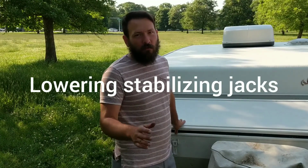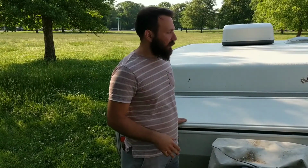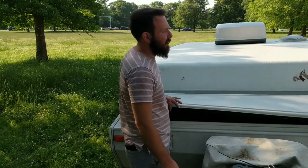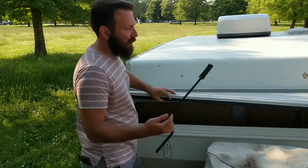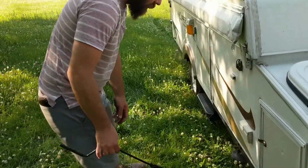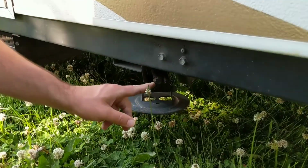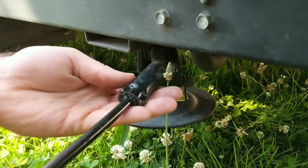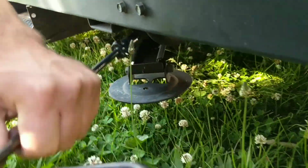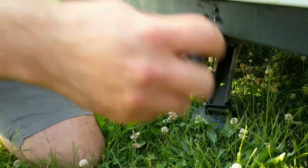Alright, now that we've leveled the trailer front to back and gotten it pretty level, we're going to try to level it and stabilize it with the 4 feet that are on each of the 4 sides of this camper. The tool that you need is right here in our storage bay, and it comes like this. Follow me. You're gonna take this unique tool and slide it right into this guy like this. And then simply turn it so you can see that the foot has pretty much grabbed the ground.